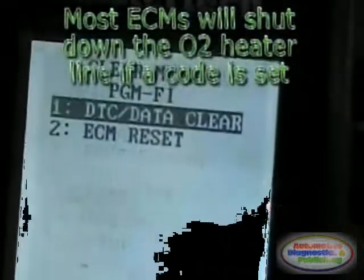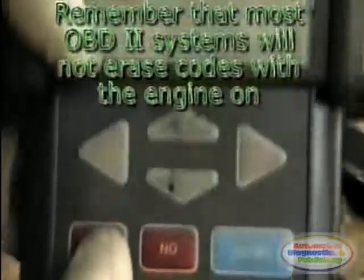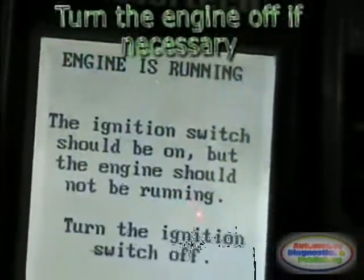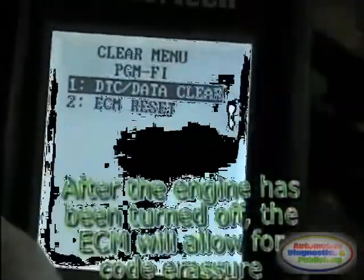An important factor to remember during all O2 sensor heater tests is to erase any impending codes. These impending codes may prevent the ECM from turning the circuit on and sending you in the wrong diagnostic path, thinking that there is a problem with the actual wiring. The ECM does this to simply protect itself against any short circuit present. If this code is not erased, the O2 sensor heater circuit will always be inactive, and you may also suspect a faulty ECM, which is really not the case.